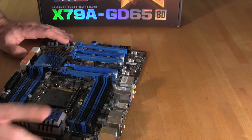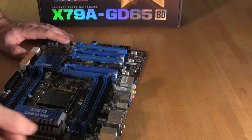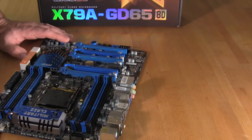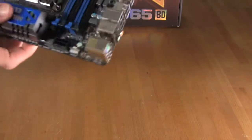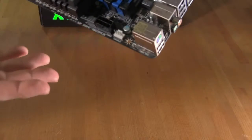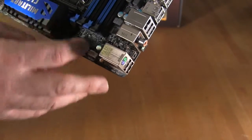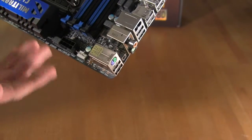One other thing to look at is the 8-pin auxiliary power slot, which is in probably one of the better positions we've seen. Normally it's so difficult to reach that we'd recommend an extension cord, and we still recommend one, but the clearance here is much better and you can actually plug it in after the board has been installed in a case.